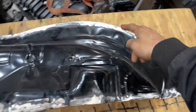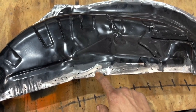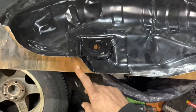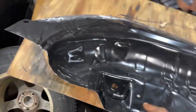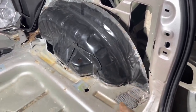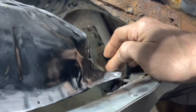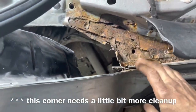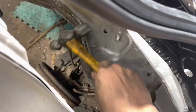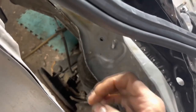We've got our panel prepped for installation — holes are in there, they don't have to be perfect. If a hole is too high you can always drill one a little bit lower since this goes on the outside. We've ground down the bottom edge especially where the new floor is going to be. Now we need to test fit the panel. If we didn't do a good enough job clearing material out, we might have to trim this edge just a little bit to get it to fit down in here properly. We also need to fit it for our floor repair.